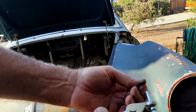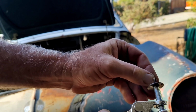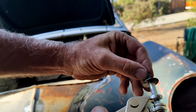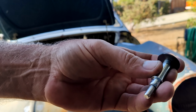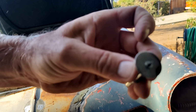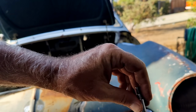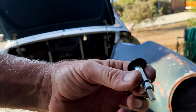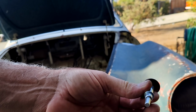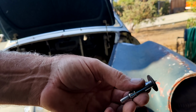But throw it in your butt weld, put the washer on the other end, put the little washer on, which normally goes right on. Not being nice. There it is. Which goes on like that. And then that will hold those two layers together, and it's spring loaded. You can kind of move it around and get it to hold a nice butt. So sometimes these Cleco clamps being used this way can be really handy to use.